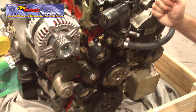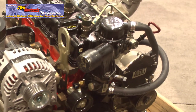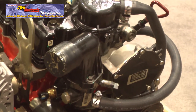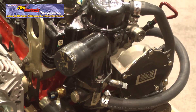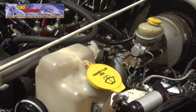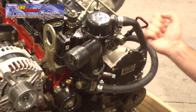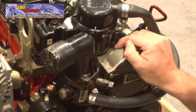One thing that's kind of unique: diesel engines don't create vacuum. Since we're certifying these engines for gas-to-diesel replacement, the 4BT crowd is familiar with going to a hydro-boost brake booster setup, or running an electric pump for vacuum-assisted HVAC controls. This engine has a cam-driven vacuum pump, so you can plug your brake booster right into it, your HVAC controls right into it — anything you need vacuum for is cam-driven.